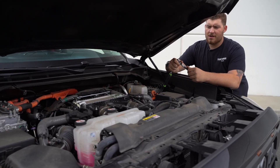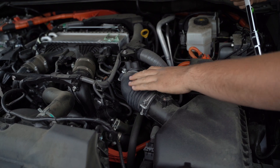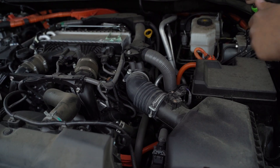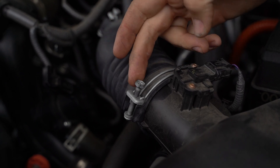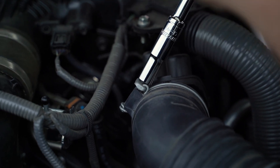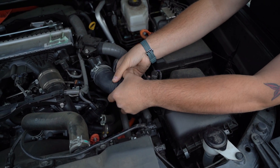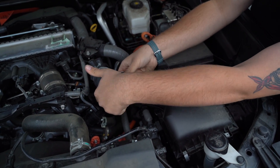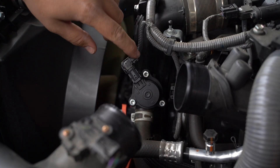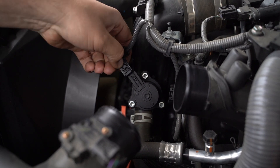This vehicle has two diverter valves and we're going to start on the left-hand side. We're going to take off this intake coupler here — you can see it's on the left side of the vehicle by the indicator. We'll take off the first clamp and the second clamp; you can either use a Phillips or a 10 mil socket on these. Now you can clearly see the factory diverter valve right here.